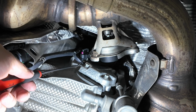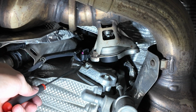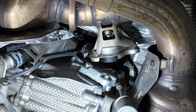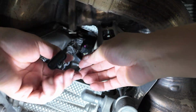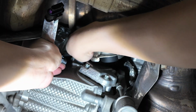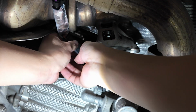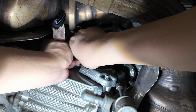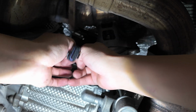All right, so I had to do it off camera just to be able to completely get my hands underneath there and actually see what was going on, but I obviously have it undone. It's right here, dangling. And same idea, we'll take the keys harness here that we've already fed down through here, go ahead and plug the old harness into the female end of the keys harness, and then we'll take the new male end of the keys harness and plug it back into the valve. So make sure it clicks in and then lock it just like so.